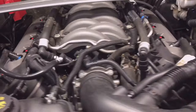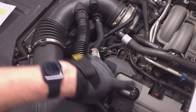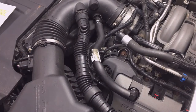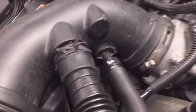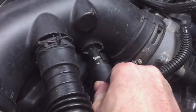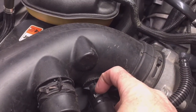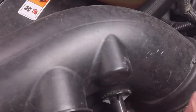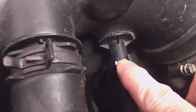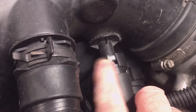On the driver side you have to take this crankcase breather tube off. The little spring-loaded tab to release it is down underneath, so this will be a good example of how to take it off. You take the tube, push it in — that releases the pressure on the plastic spring — then pull it this way to get around the little plastic notch right here.